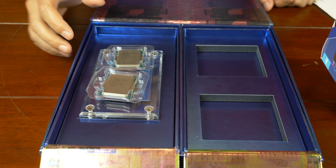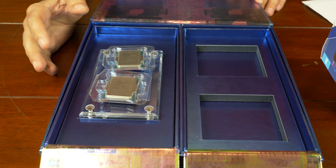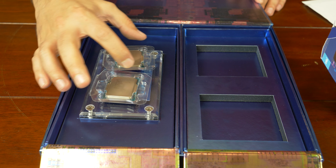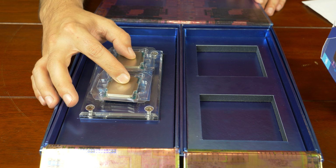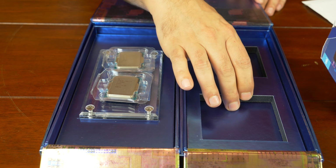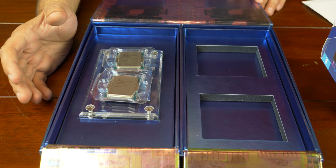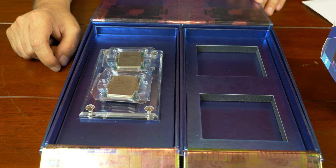But anyways, we got these two CPUs and RAM. We should probably go over RAM speed. So both of these support DDR4 or DDR5. There are no motherboards that support both; there are only motherboards that support just DDR4 or just DDR5. Basically, these two go up to 5600 MT/s as rated by Intel, and the predecessors only went up to 4800 MT/s for DDR5. Both of these and the Alder Lake 12th generation CPUs go up to 3200 MT/s for DDR4. Also, both of these and the Alder Lake CPUs all have UHD 770 graphics.